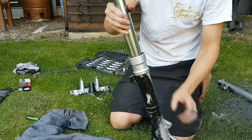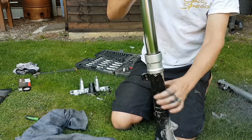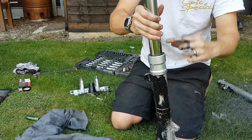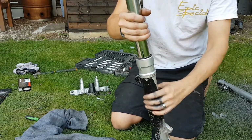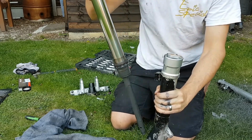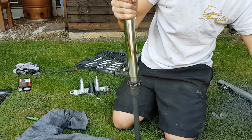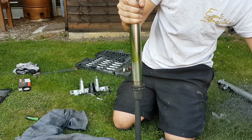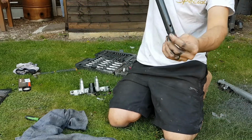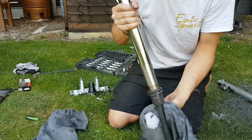So with that bolt removed, that allows you to remove the stanchion out of the lower leg. So if you slide it up to its stopper, you'll pull the bush out and the seal and the dust seal, like so. There it goes, and out it comes. So that's the stanchion. That is the damper rod. I'm making a mess. Probably going to kill all the grass.